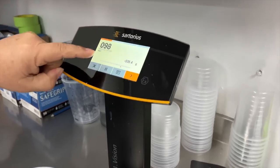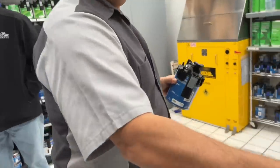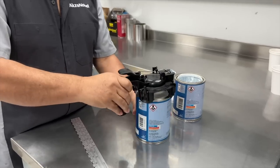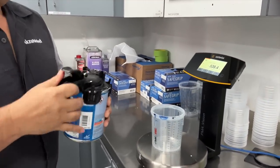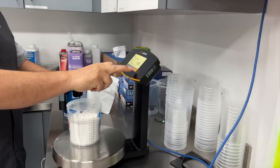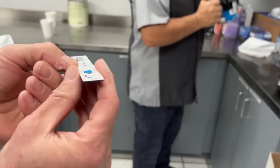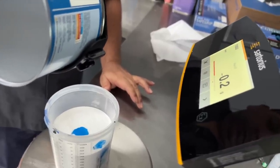The scale asks for the first toner and shows the amount. Juan selects the first color to be added, which is the base for the white color, and explains that the scale is completely computerized — it measures how much he pours into that cup. If he accidentally pours too much, it will recalculate all of the other colors needed to get the proper color. As he adds paint to the cup, the number on the scale goes down, and the goal is to get to zero. He then moves to the second toner, which adds a blue pitch when viewing the paint at an angle. Juan adds in the blue toner until the scale reaches zero.